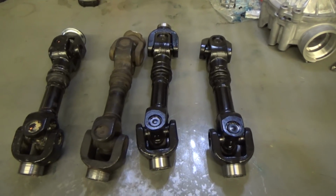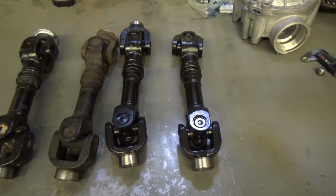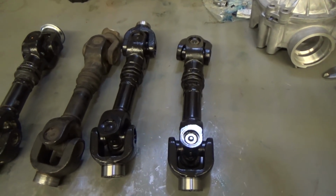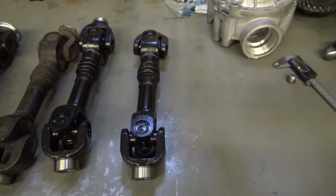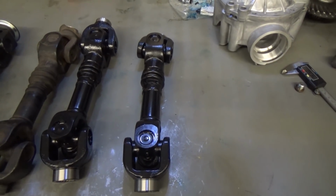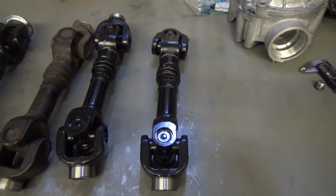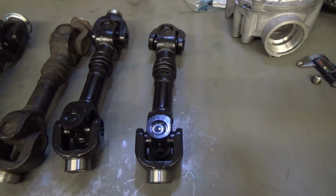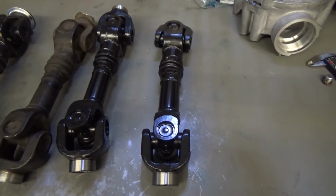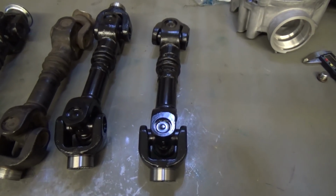So a rule of thumb in automotive style drivelines that spin anywhere from 1500 to 2000 RPM is the typical automotive driveline application. 2 degrees maximum out of phase is the upper service limit. Now keep in mind that these prop shafts are turning very close to the same speed as an automotive style. The only exception here is that the U-joints run on a much steeper angle. So your 2 degrees out of phase is going to be amplified severely through the U-joints and cause damage much quicker.